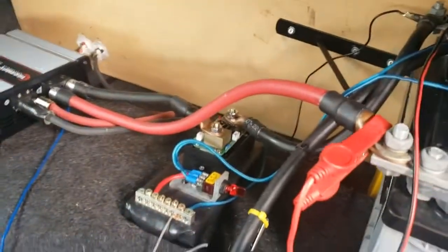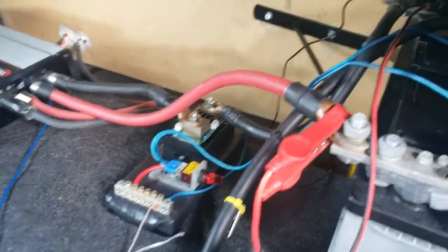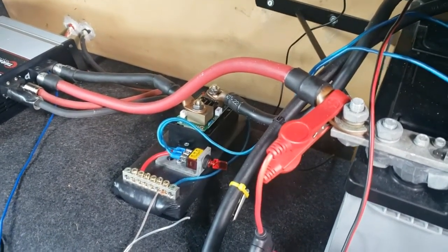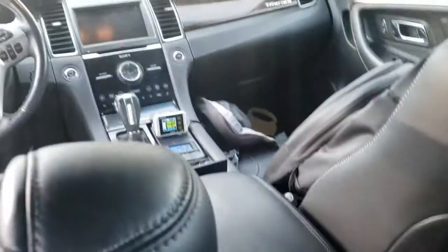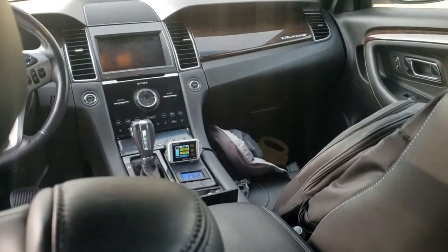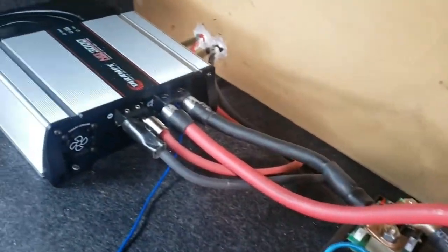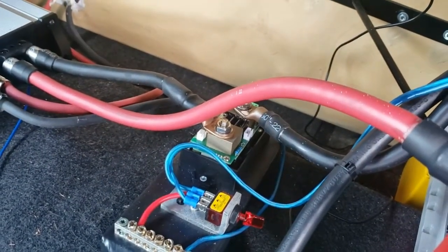They make a couple of different versions — I believe a 75-amp one, a 150-amp, and I went ahead and got the 300-amp one. In the second part of this video I'll show you what it reads. The most I've ever seen it pull as far as amperage is about 125 amps, which could have to do with the battery being older or only having single-input, smaller gauge wire. Check out the video — I'll put a link in the description below.